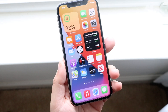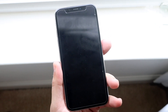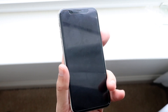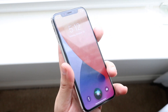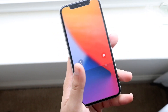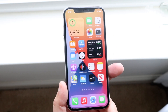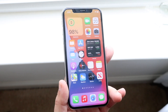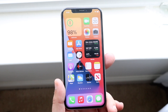You may actually have to do a restore from a previous version, but one way I was able to fix it when it's happened to me is to hold down that power button until it eventually restarts. I know that sounds crazy, but just holding down the power button on the side — whether you have an iPhone 8, 10, 11 Pro, whatever — eventually something clicks on to turn on the phone. I've had this happen to even my iPhone 7s back in the day, where I had to hold down that power button until it eventually restarted and it would just boot into the OS.